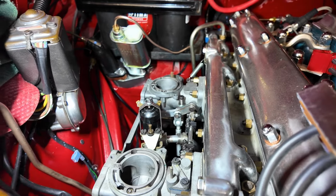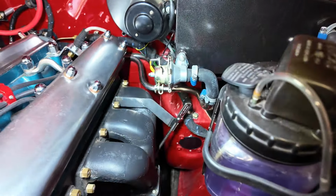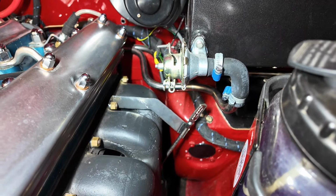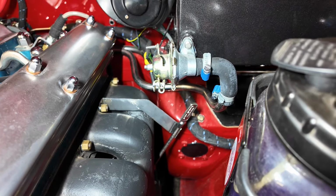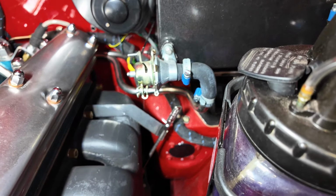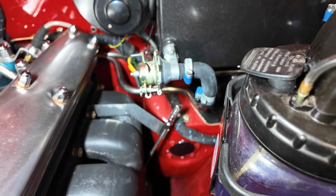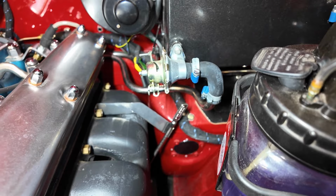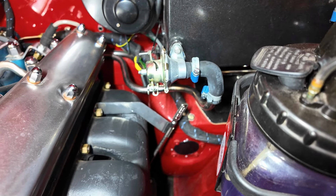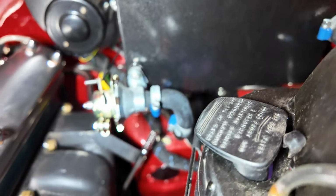The other thing I have discovered, I was getting coolant on my exhaust. Yeah, these are leaking. I tell you what, this Evans coolant, great. But by God, does it find the leaks. So I've got to tighten them up a bit more. The problem is the valve where it connects to the heater box there. It's not the hose clamps that's the problem. It's the connection to the heater box.